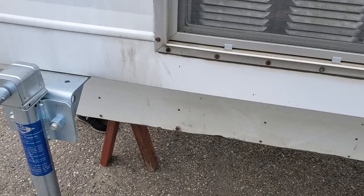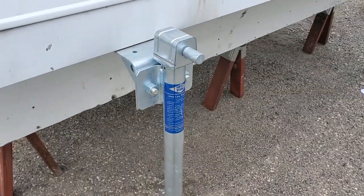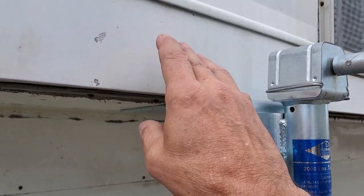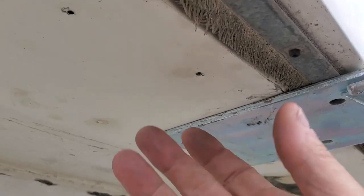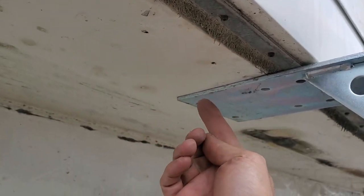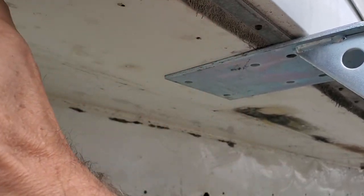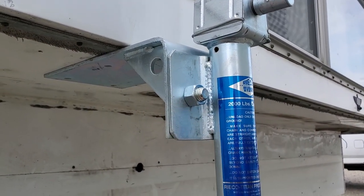So these are the heavy duty Rico Titan brackets, and these things came with this. They're some big dough, I believe around $1,000 US. The plan is you mount these brackets onto the sides of your Alaskan camper, and you can see it just bolts up here. This is the outside wing, and inside I would have to put some gussets or plywood, some metal, steel, whatever, to help support this span, and then it would bolt through to this, and this guy would stay on it.